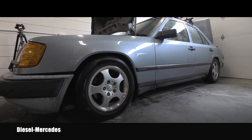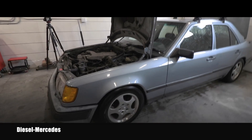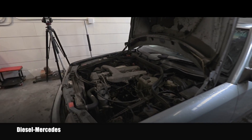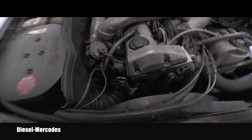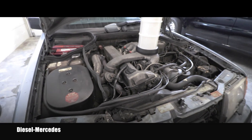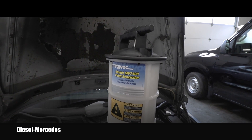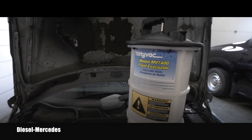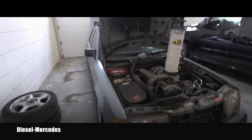Also, as you can see, it's beautifully lowered, so getting underneath will be more work. Another reason for this alternative engine oil change is that the filter is actually not underneath the vehicle but up here and very easy to access. The dipstick pipe is right here too. I'm pretty sure you'll perfectly agree that's a perfect scenario for using this MightyVac fluid evacuator for this job.